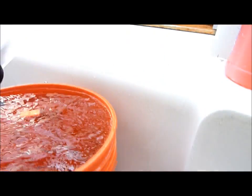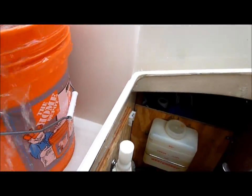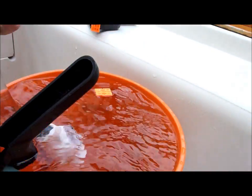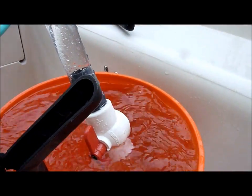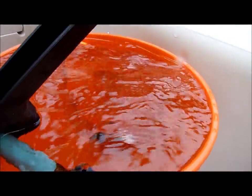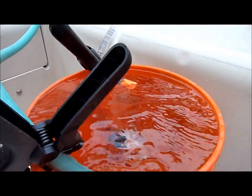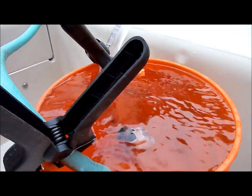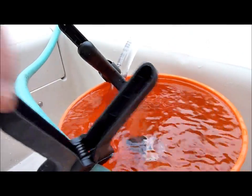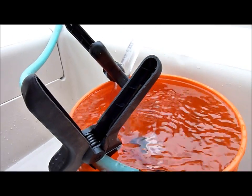But because this hose here, right now, is higher than this point, when you shut off the engine, you need to be very careful that you either immediately pull this hose out of the bucket, or, as I've done, I put on a valve so that I can't flood the engine by siphoning from the bucket and into the engine. Impellers and impeller pumps are not positive shutoff devices. Depending on where those vanes stop, or if you had a broken vane, you could very easily flood your engine and do what's called hydrolocking, which you just don't want to do.